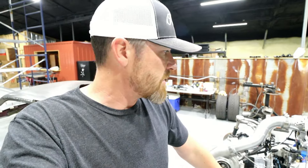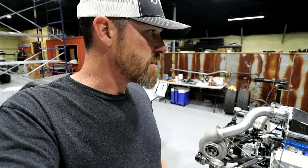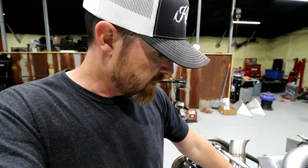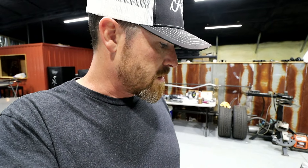All right guys, there you go — that's the basics of a turbo setup. I didn't go into a lot of detail but like I said you can kind of wing it, put these things together. I've seen some pretty rough setups that work pretty well. If you're just wanting to do a budget setup on your truck, car, or whatever — that's the basics, just figure it out from there. I'll drop some links in the description for some of these components on the budget side. A lot of this knockoff stuff is copied from higher-end companies but uses lower quality materials — the wastegate valves and seats may burn up after a while, but you can actually buy the good quality valves and seats to rebuild them since they're almost an exact knockoff. Thanks for joining me!